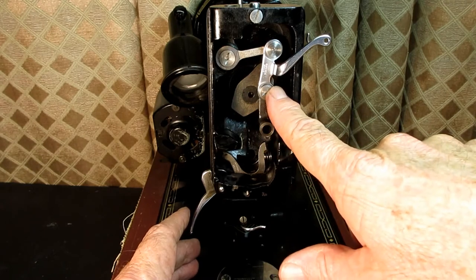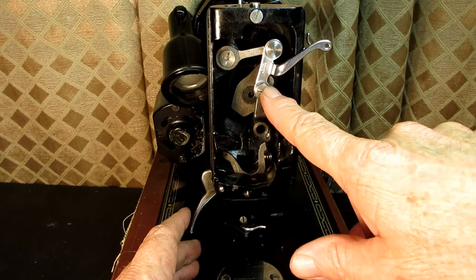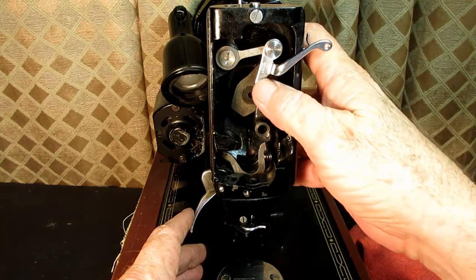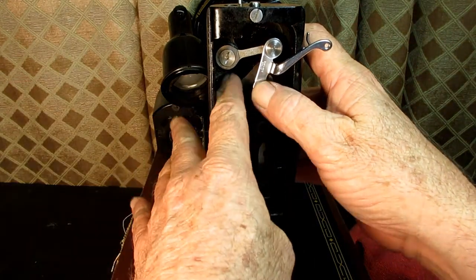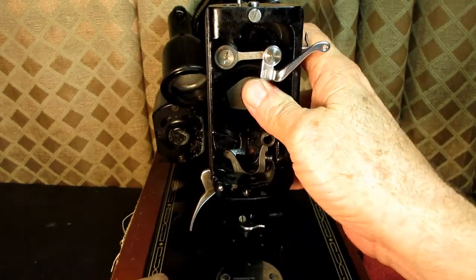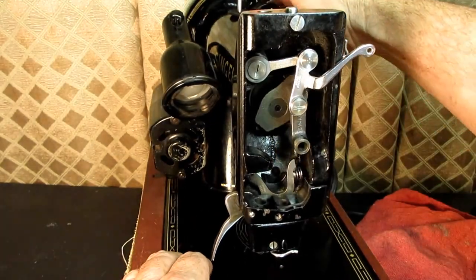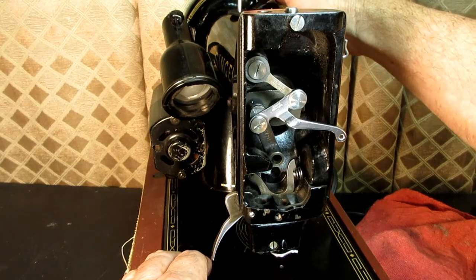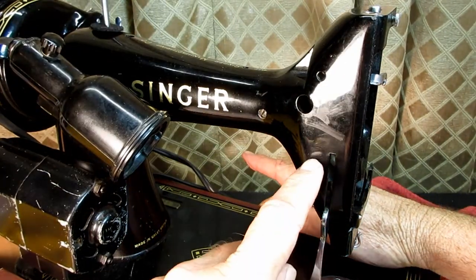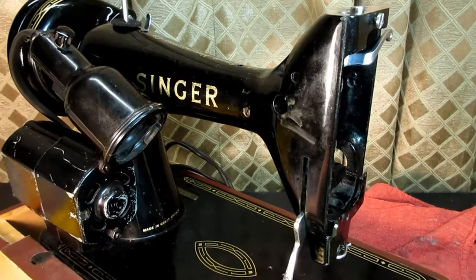To tighten these up, the first thing you want to do is tighten the crank one, because it's very easy to determine the position. You just push it in against that counterbalance so that it's flush. You feel back there and it's flush. Their pieces are together. So that's real easy. So you just turn that over to the position there where you can look in here and you can see that set screw. I think I can see that hole now.